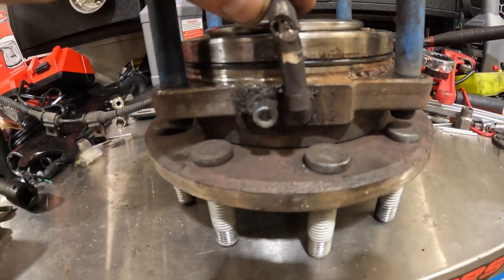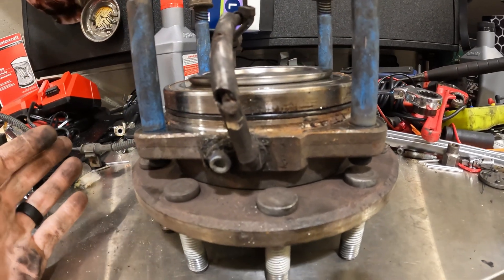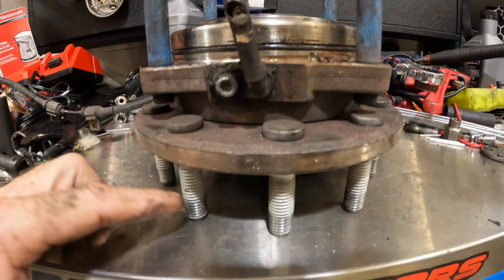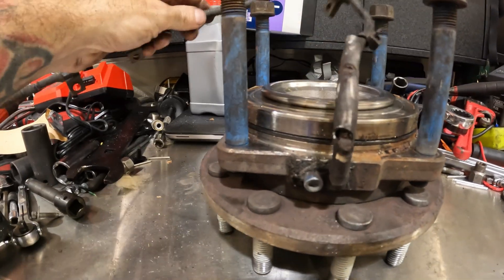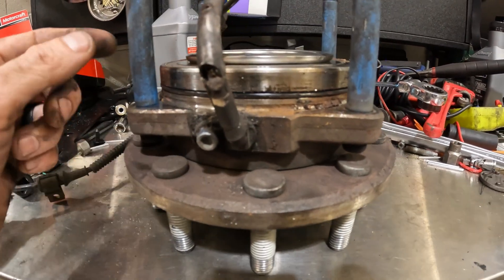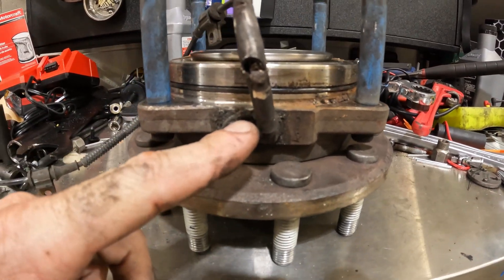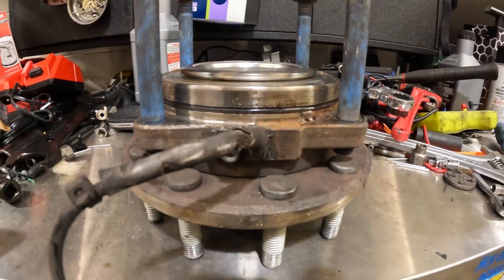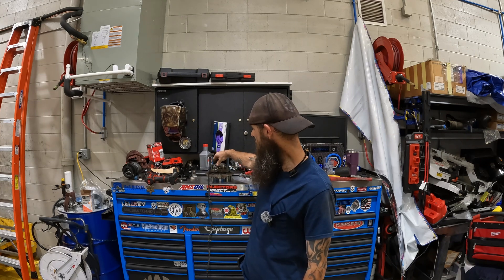Now you can replace just the sensor — that's a five millimeter hex. You still have to take the brake rotor off, which means you have to take the hub off. Then you use a five millimeter Allen, take that out, pull it out, and undo all that. But this thing has 300-something thousand miles on it — the original one. So I figured if I'm going that far, I'm not just going to replace the sensor; I'm going to replace the whole hub, seeing as I have them here in stock. That's why I was getting the circuit code for the ABS — it just sliced the wire and can't communicate with the ABS module or anything else on the truck.